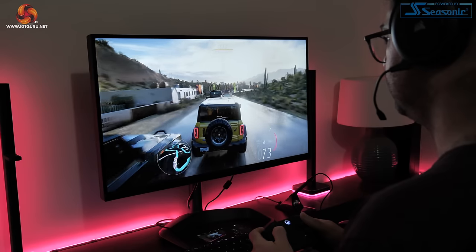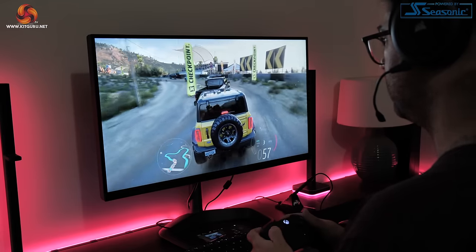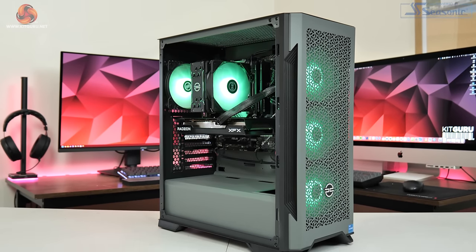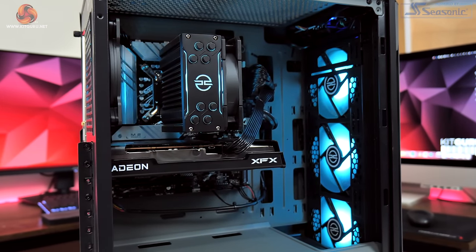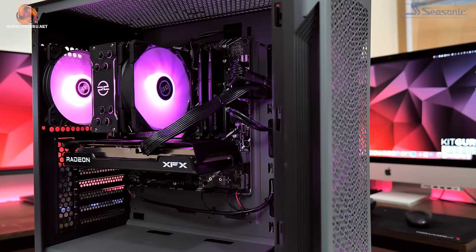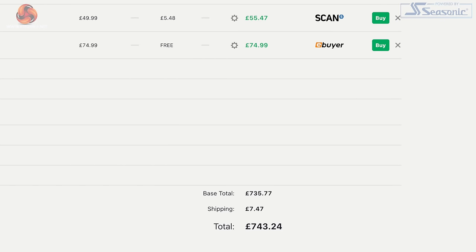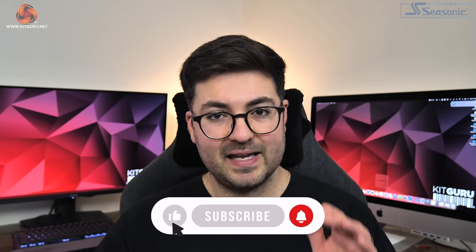You're not going to be playing the latest AAA titles at ultra settings, but for esports or games like Forza Horizon 5, we did see solid gaming performance even at 1440p. No system at this price point is going to be perfect — the case does feel fairly cheap and flimsy, the DDR5 memory only runs at 4800 MT/s with CL40 latency, and the decision to use a micro ATX board in an ATX chassis leaves a lot of dead space. That said, PC Specialist is offering compelling value — I used PC Part Picker to work out an equivalent DIY build at just over £740, meaning PC Specialist is building, shipping, and covering the system with a 3-year warranty for barely £50 more. If you or someone you know is looking to get into PC gaming without building their own PC, the Cobalt Spark R is a solid starter system.